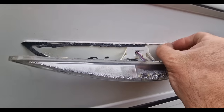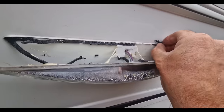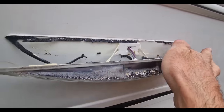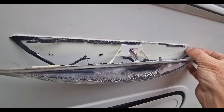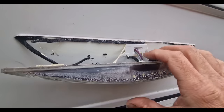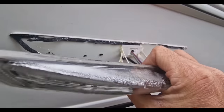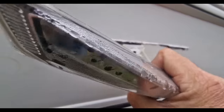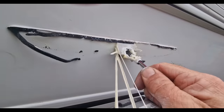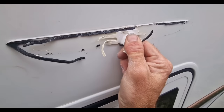Then all we'll do is go through and clean all the sealant back off again, being very very careful not to hit the paintwork or put any scratches in. Remove all of the sealant and it should then be able to come out with a bit of a wiggle — we'll tidy it out because we're going to want to put all new sealant in.